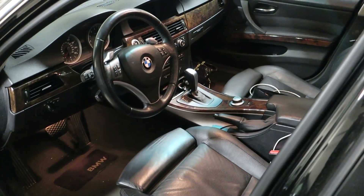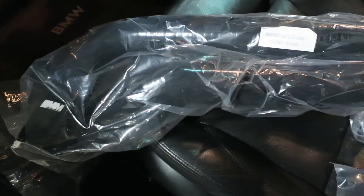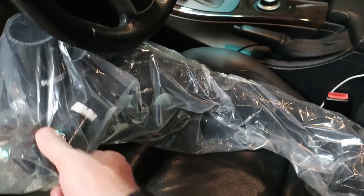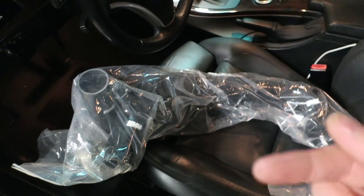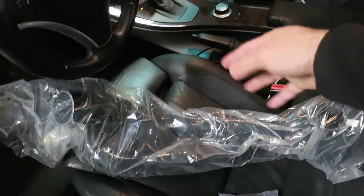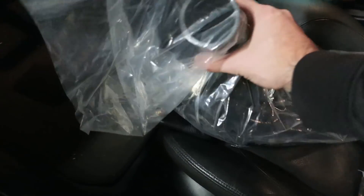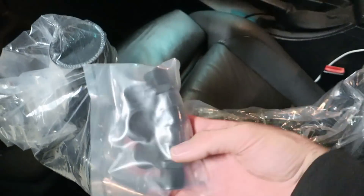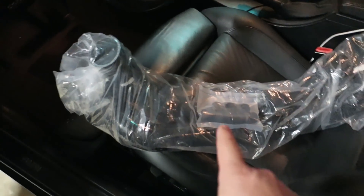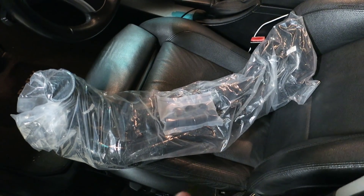Before we go down the road, let me show you what the inlets look like. I went with MMP — it's a local company here in the Houston area. I went to pick them up in person, so I saved on freight. These are the stock-side or factory-location inlets with the stock 1.75-inch turbo snout. I'm not planning to upgrade turbos on this car, mostly because I don't think the transmission can handle the power that upgraded turbos would make. The kit comes with two tubes, clamps, and fittings to either cap off depending on whether you're running your factory diverter valves or not.